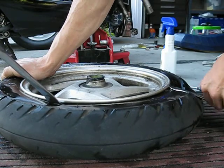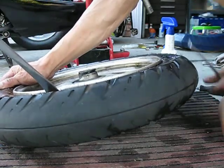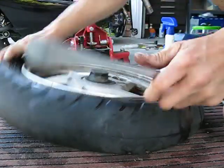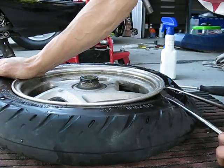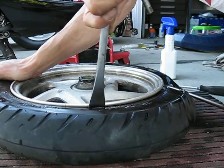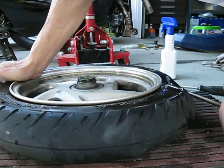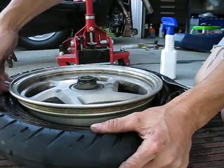I'm going to pop it off. What this does, when you work it all the way around like this, is it kind of slides the tire inwards — in towards the center of the rim — a little bit at a time. Eventually, when you make it all the way around, all of a sudden it just pops out.